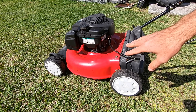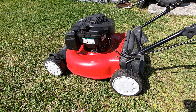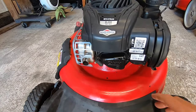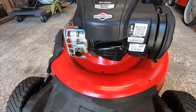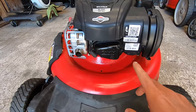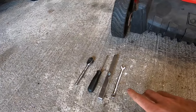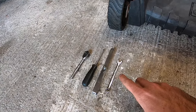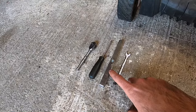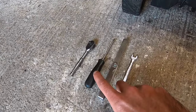When I first tried it I was able to get a couple little sputters and backfires and that's pretty much all I've gotten out of it. So let's get it back into the shop and get it fixed. The problem with this machine lies right underneath this cover on your valve train. We'll go ahead and pop that cover off - we just need some real basic tools for doing this job, a valve adjustment. I've got an 8 millimeter and a set of feeler gauges and a T10 Torx driver.